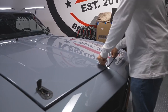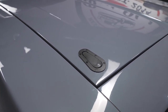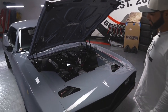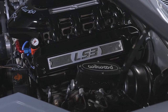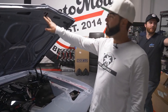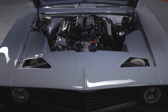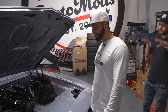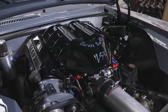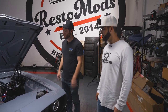The idea of putting these aero catch latches on here was partly due to something that's under here - that puppy right there, an LS3. What's going on is we have a pipe that goes through here which is the intercooler. Normally on a Camaro you have your latch that goes right in the middle to latch the hood, but that's not possible because we have a big front mount intercooler. So we had to put latches on there to secure the hood. Tell me about this LS3 and the twin turbos - it's gone through some changes over time, right? Tell me about the modifications done here.